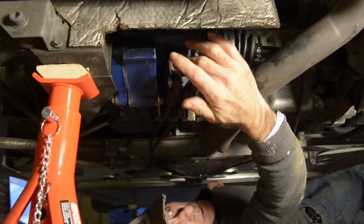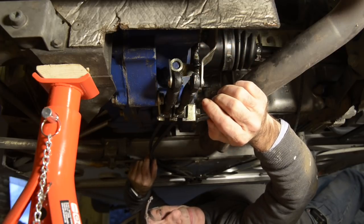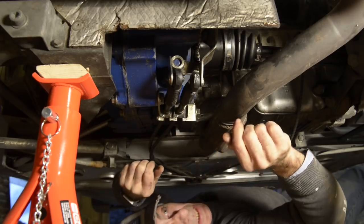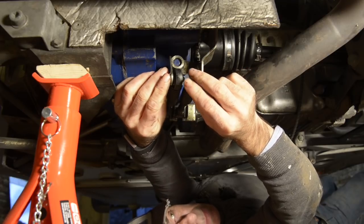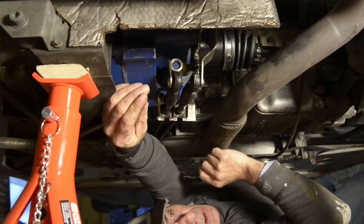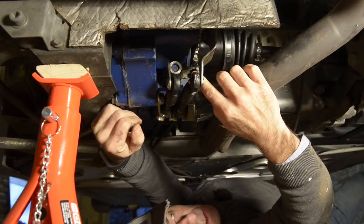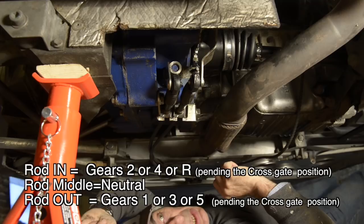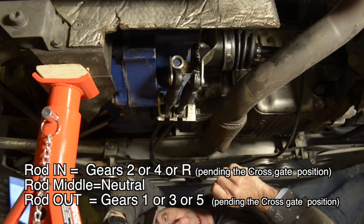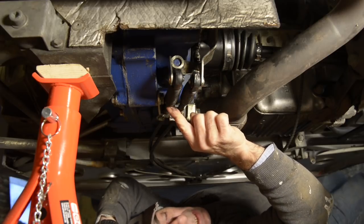The cable on the left is the one that actually moves the rod in and out — the rod which goes into the gearbox. If I push the stick shift forward, the cable pushes this rod backwards. The middle position pulls the cable back a bit — that's the middle position. If I move the stick shift all the way to the back, the cable pulls more and moves the rod all the way in. So we have three positions: in, middle neutral, and outer — corresponding to gear pairs like first and second, third and fourth, fifth, or reverse.